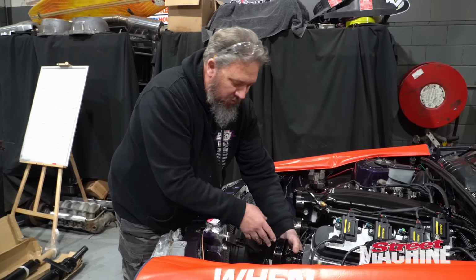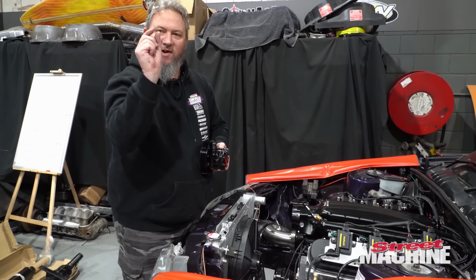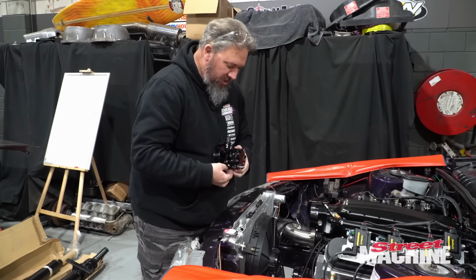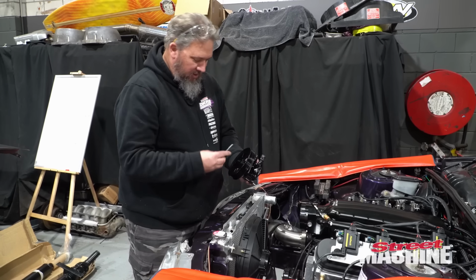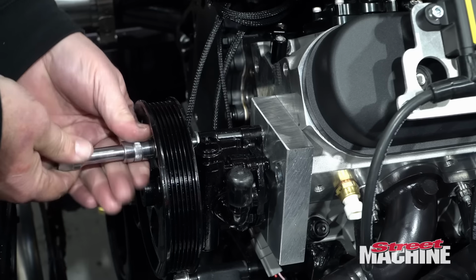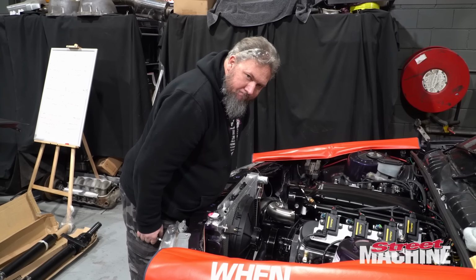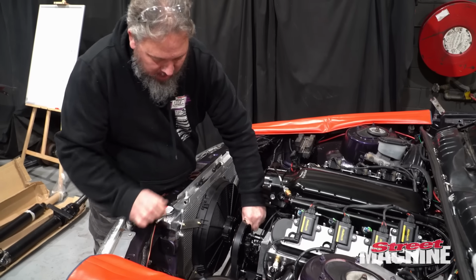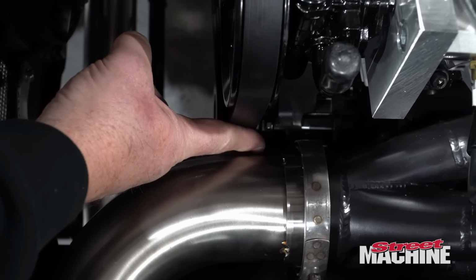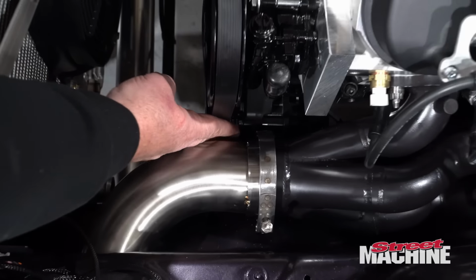So originally this sat quite a fair way over here. So the belt running past this header was like, oh, that far away from the header. So now, hopefully, through the power of machining, it is somewhat further over. All right, it is definitely better. Like you could not have fit your finger between there before. It's still close, closer than we would like, but there is certainly a lot more clearance than there was.